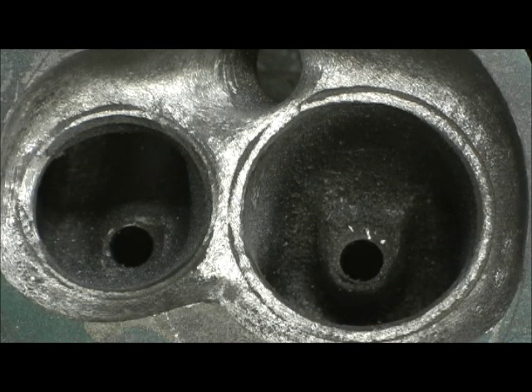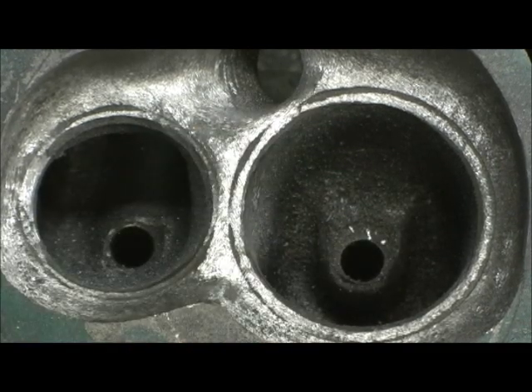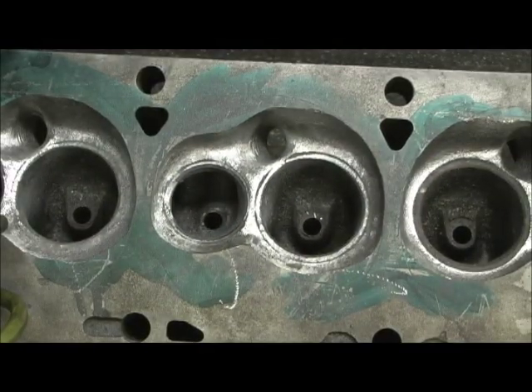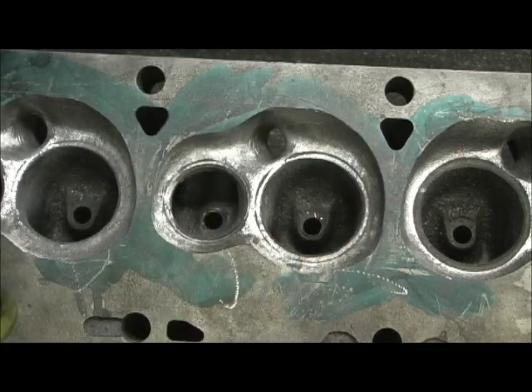You have to make space — layer it down, come down. I have lowered this whole combustion chamber floor probably around 30 or 40 thousandths from that ridge. This has been a really difficult chamber, but I was after a certain shape, and as you can see, I do believe I got it. It might not be the latest shape or the newest bells and whistles from Brodix or Dart; however, it is so close to a current state-of-the-art shape. We've got to remember that this head was made the year I was born — 1960.